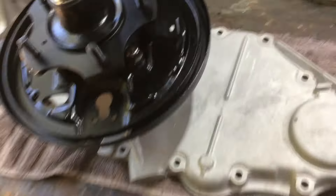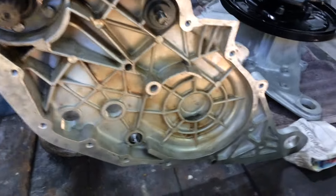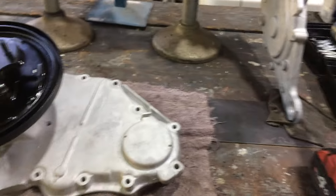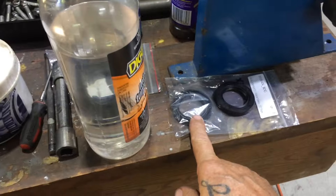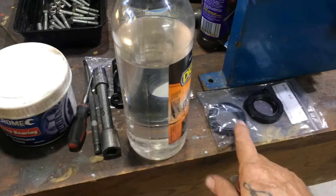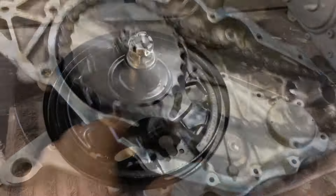I'm just going to put gasket glue around here, put the gasket on, then grease the other side and flip this one on. It took me a bit to figure everything out - there's all sorts of stuff that can go wrong. You've got to make sure you get all the seals in the right spot because both seals, even though they're different sizes, the center's a different size - if you put the wrong seal in you'll have to pull it all back apart.